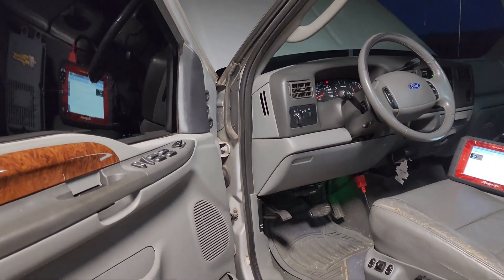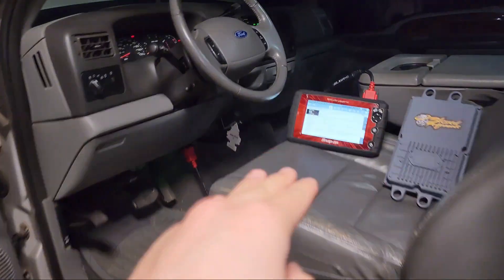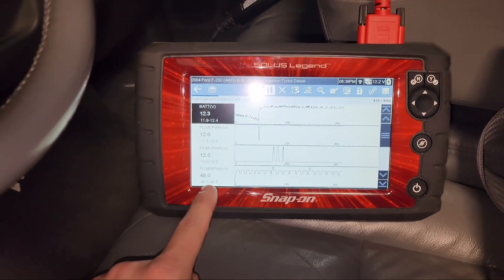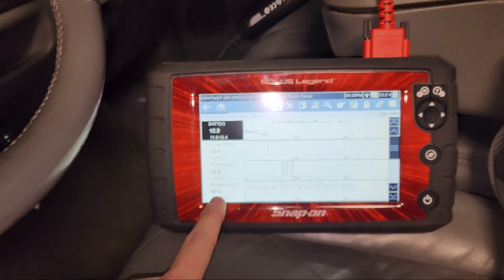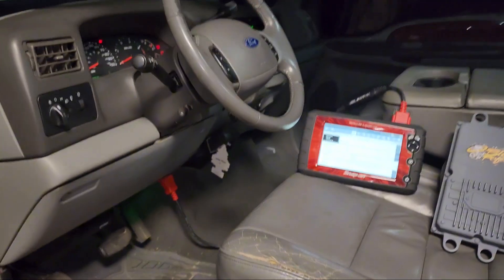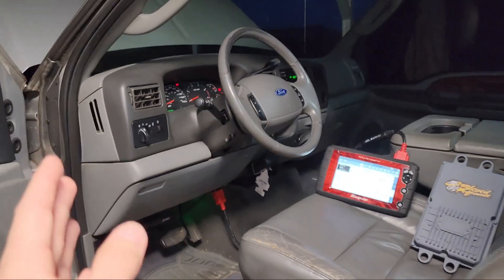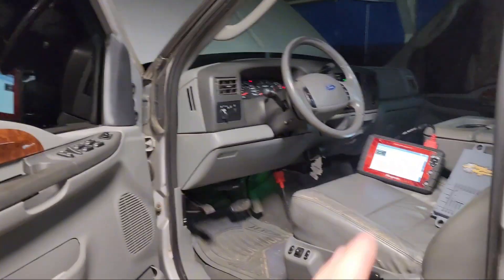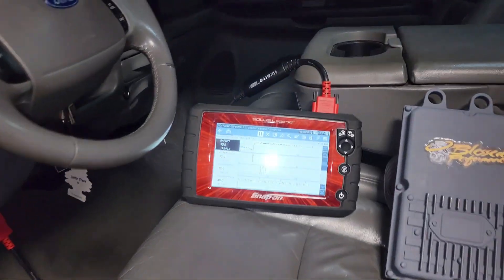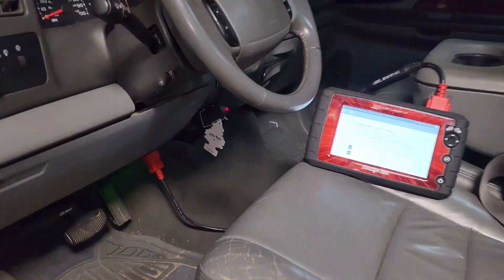You need to look at your harnesses, your pins and connectors - make sure everything's fully seated and connected, no rubbing, chafing, damage or breakage. But since I can physically see that my output is dropping below 47 volts - you do not want to go below 47 volts, maintain 47 to 49 - I know the FICM's no good. So I'm going to get this Blessed Performance one thrown on here, hook the batteries back up, start it, and we should be able to hear and see a difference on the scan tool.